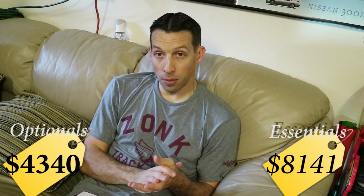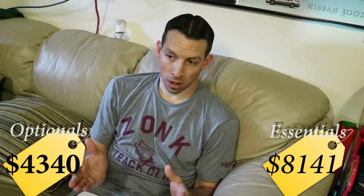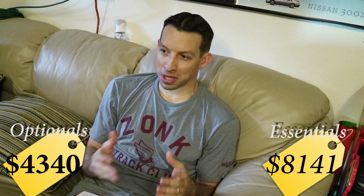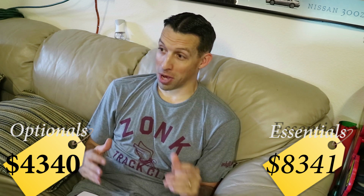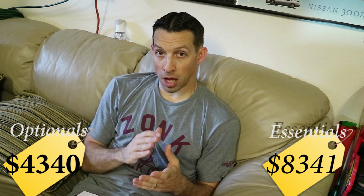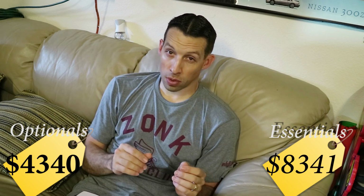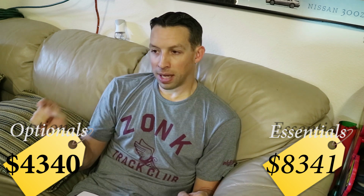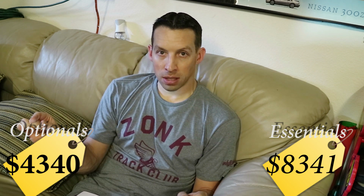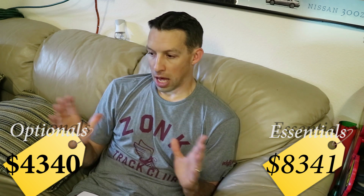The RB26 flywheel, I actually bought that used, came with a Nismo clutch. I probably could have used that Nismo clutch, but again, I went with the information that I had. It was $200 on eBay, man. But the transmission that I got was a pull type transmission. I needed to convert it to a push type. And to do that, all you need is an RB25 clutch slave cylinder. The places to mount it already exist on the RB26 transmission. You just gotta tap and drill the holes and you're good to go.